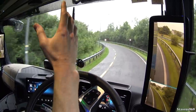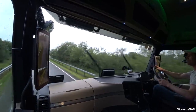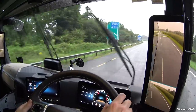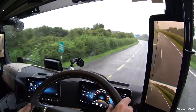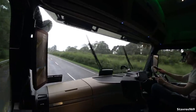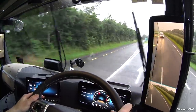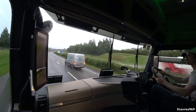I have the heated lens on the camera to clear any water beads off the lens — and you can see it is still quite clear. The monitors could be a bit crisper and the bezels thinner, but still quite nice to use. These mirror cams can take quite a knock — they flex in 65 degrees and outwards 35 degrees, so even hitting a tree you can just push it back. Should you actually break a mirror cam, temporary mirrors attach with two bolts at the bottom and two on top to get you back on the road.